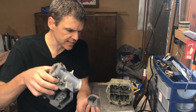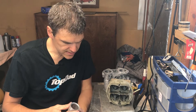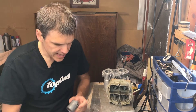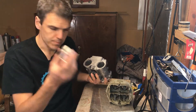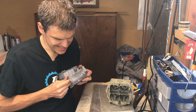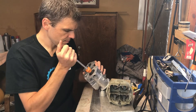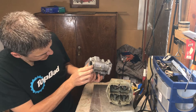This is the aspect of tunability of the Weber carb: you can take this, which is the choke - the equivalent of this - and this, which is an auxiliary venturi, which will be the equivalent here. In a Weber carb it's really very easy to do - you just pop a different one in here. You have to put it in a certain way because of the guiding, but you just put a different one in here.